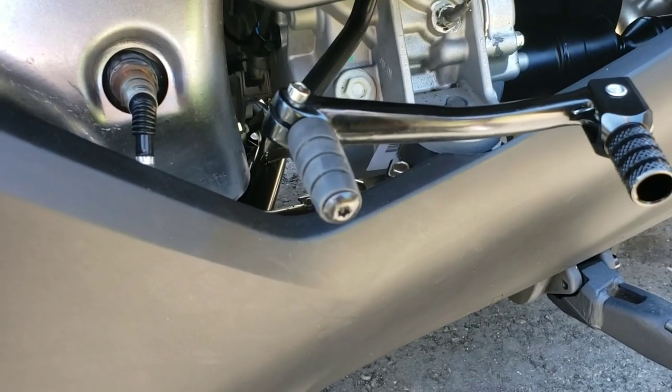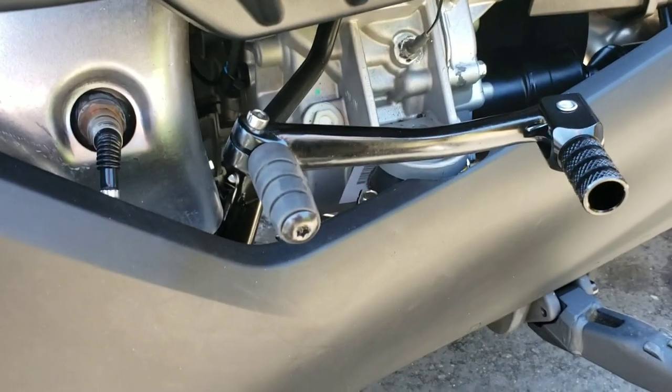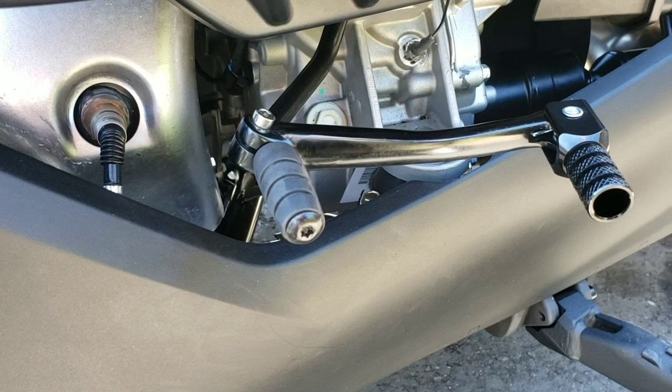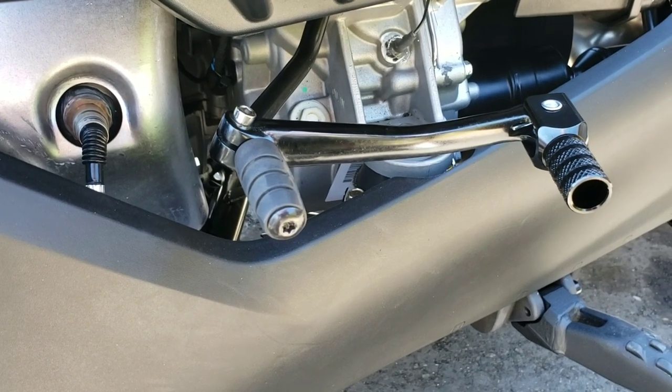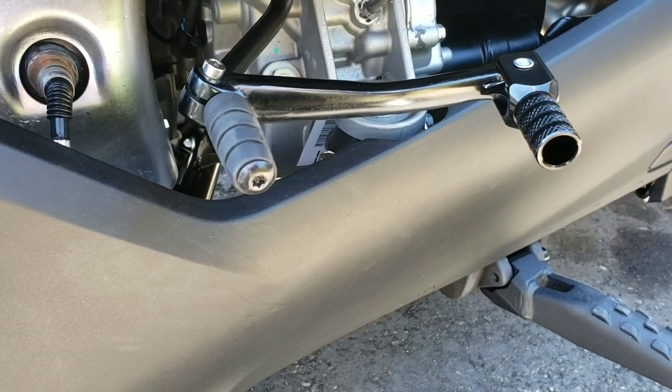You can try to open it up bigger, but the first one we tried that on actually cracked because it's just aluminum. You're better off knocking some of those teeth down rather than risking cracking it. Just be careful not to get it too hot, as that will soften and weaken the aluminum.